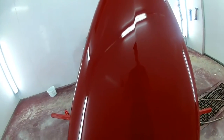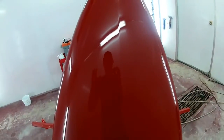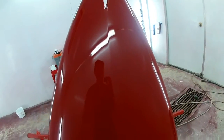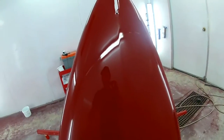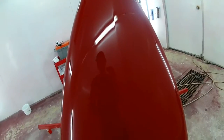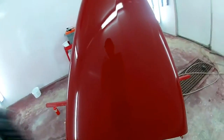Just always remember when you're at this step that any sanding marks that are still present, this stuff will not take out. Like I always say, when you're wet sanding with 1,200 grit, 20 minutes extra will save you 40 minutes when you're using the 2,000 grit. 20 minutes extra with the 2,000 grit will save you 2 hours on buffing with a cutting cream with the Presta Ultra. Buffing with the Presta Ultra will save you 4 hours of this stuff. It's really just exponential time saving when you do the job right the first time around.